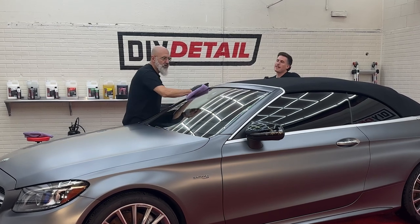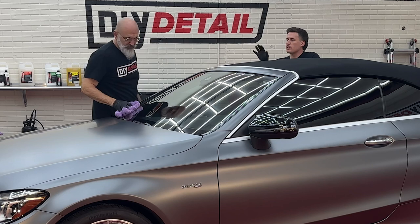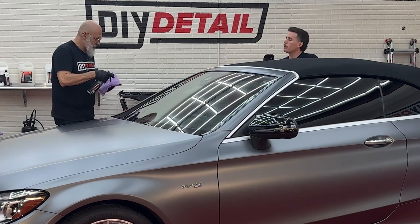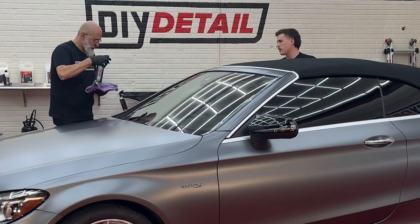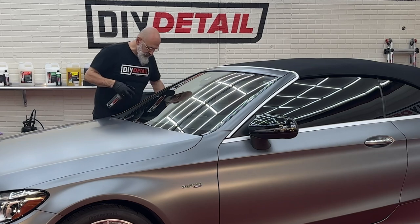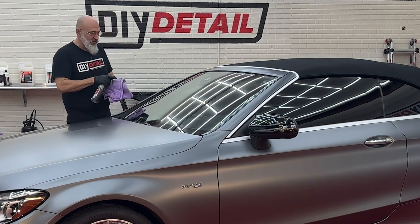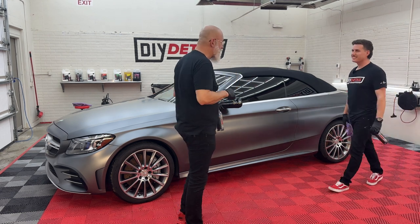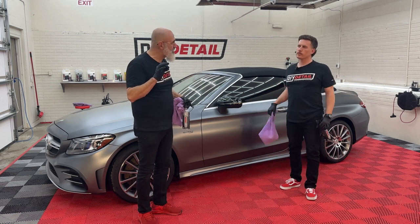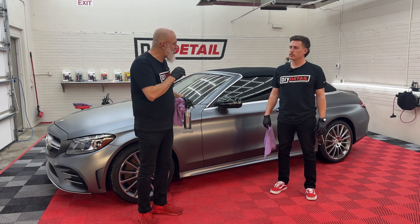Ivan taught me a while ago to always fold my towels after washing them. One great reason is so you can inspect the towels for debris — you may end up using these towels on paint later and they could scratch it. Same thing for why we take the time to panel prep thoroughly before coating: you're inspecting for any missed spots, water drips, or anything the clay towel didn't get. Also, if you polished the paint, it removes any excess polish left on the surface. In this case we did not polish this paint. The ceramic coating will make it a lot easier to clean, and it is going to increase the sheen just a little — not enough to make a big difference, but enough that it will look richer and the color might look just a tad darker.